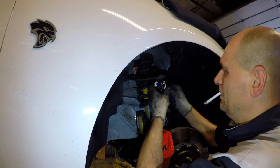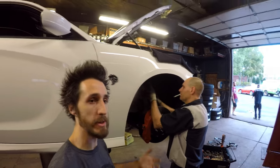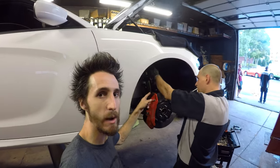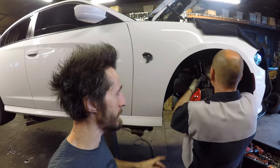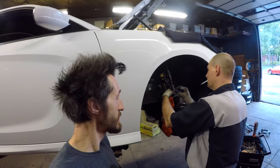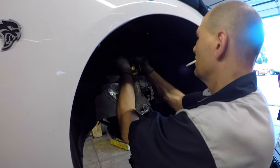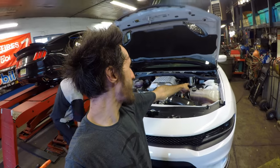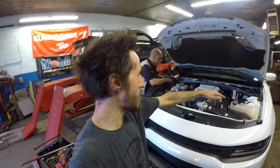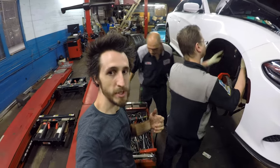They are actually coming off with the puller, so might as well use it. We opted to do the upper control arm before we did the replacement of the lowers. He's locking it in place right now, then going to tighten it, and you'll hear a pop — it'll pop right out. Very little torque required to get them out; you'll hear a pop after a few good turns. There it is — the uppers are free to come out. Then we'll work our way to the back and do the bushings after we're done with this, and then it goes on the alignment rack. You're going to have to get the coolant reservoir off and the strut cover off on the driver side, and loosen the strut bolts to lower the coil and strut just a little bit so you can get the bolts in.